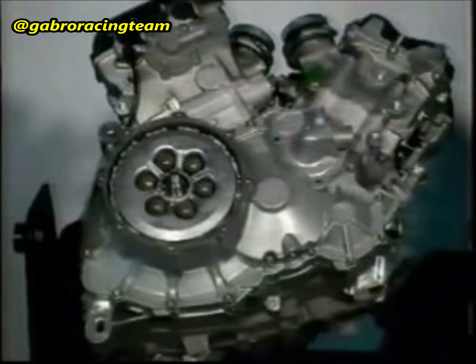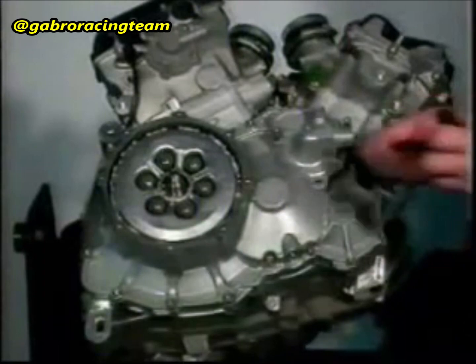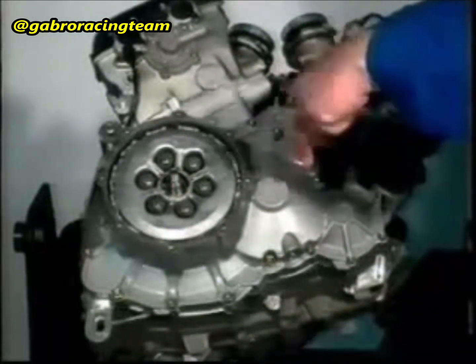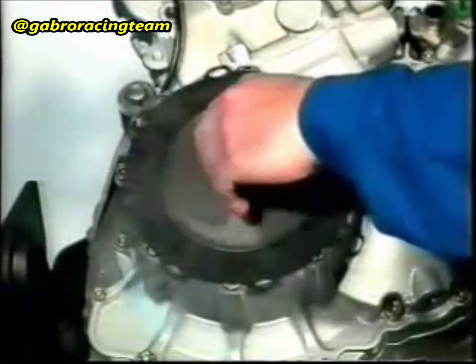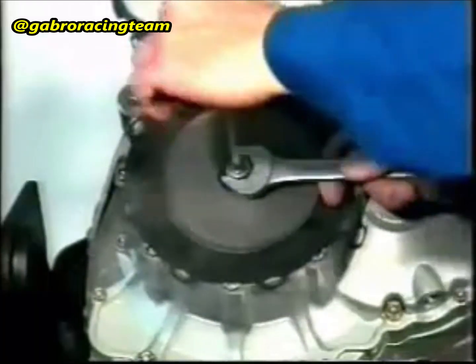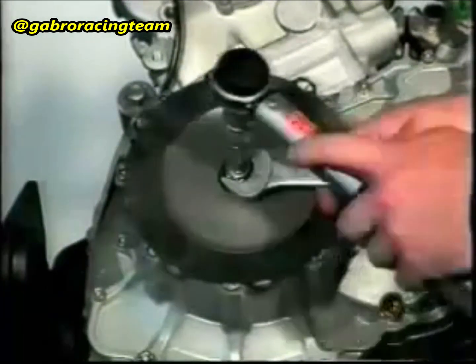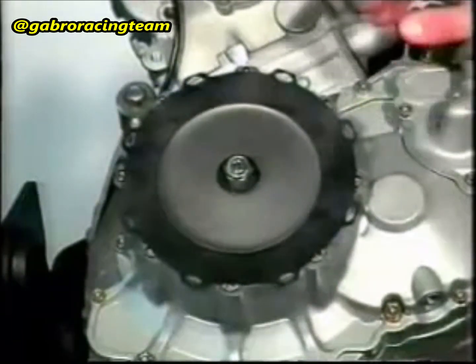Insert the gasket into the water pump casing and fit it onto the clutch cover. Fasten the water pump casing with 4 M6 screws. Attention! A new packing ring should be used for the cheese-headed drain screw. Fasten the M12 screws. Attention! The diaphragm must not be fixed to the projections of the clutch cover. The tightening torque is 30 Newton meter.